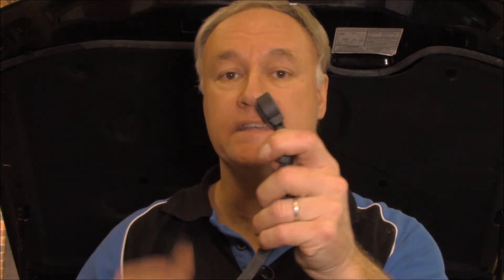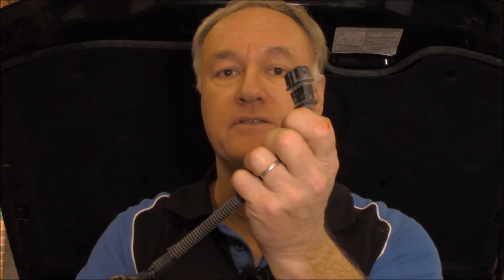Generally speaking, the only way to get these sensors to play up is under hard acceleration under lean conditions. So create a vacuum leak, floor it, and then you should be able to see a pattern on your oscilloscope or the ignition timing being retarded on your scan tool. Keep in mind that these sensors usually have a bias voltage going to them — five volts coming from the ECU. If you disconnect the sensor you should be able to find five volts from the ECU, and when you reconnect it, it will drop down to maybe 2.5 or 1.5 volts. There is a bias voltage on the line, so don't forget about that.